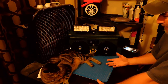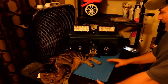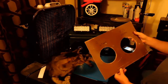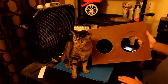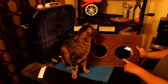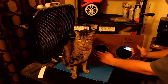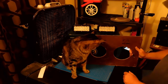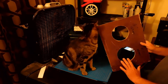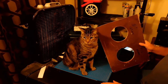So before I cut that sheet metal, I'm going to get a thin piece of wood and cut out a template. This here is my speaker measuring plate — I've got a 5.5 inch hole and a 5.25 inch hole, because even though you might have a 6.5 inch speaker, it doesn't always fit in the same hole. I've actually seen 6.5 inch speakers that fit in the smaller hole, but Polk speakers require a larger 5.5 inch hole. So I use this as a gauge to test my speakers and see what size hole I need to drill, because if you drill your hole too big, you're screwed.